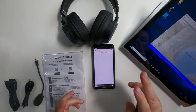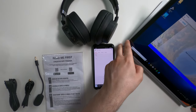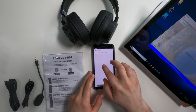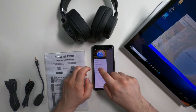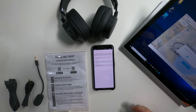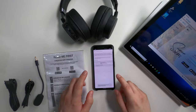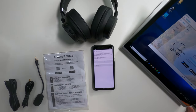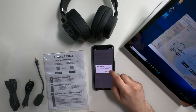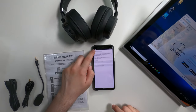I've got the app installed on both my phone and laptop. First, plug in the wireless adapter on your laptop. After logging in, go to the left-hand side and click wireless setup, where you'll see the SX-FI Theater. If clicking it does nothing, press the connect button on the adapter itself. Once confirmed, it should connect and pair successfully.